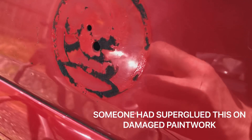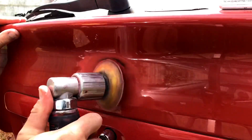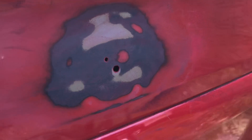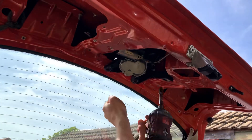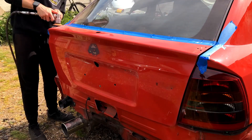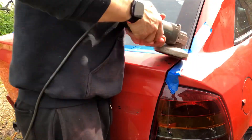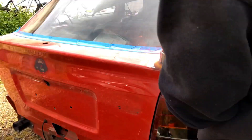When it came to removing the rear emblem, someone had super glued it on, which damages the paint — never do that. I had to sand that back basically to primer. It didn't take long, and that's the finished result. I then started stripping down the rear boot: removed the wiper and grommet, got the motor out from inside, removed the trim around the boot lock, and started sanding down the edge of the boot lid. The spoiler sits in that spot and had rubbed and damaged a lot of paint. Someone had tried repairing it in the past and it wasn't a good job, so I decided to grind it all the way back to metal and start again.